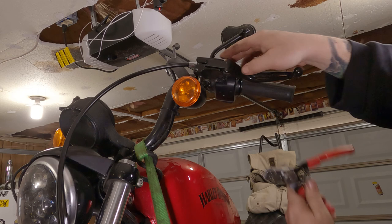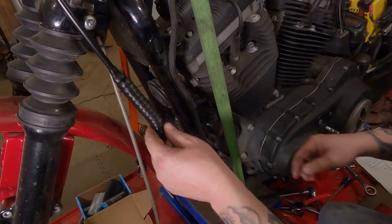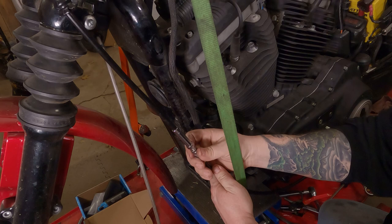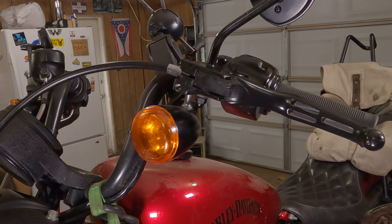Obviously, you still need to adjust the slop in there, but everything should be firmly attached now. Now on your clutch cable, slide your rubber slinky thing up out of the way. And remember, the bottom one of this spins. So you can spin that, hopefully with your hand. As you're doing this, it's essentially making the sheathing on the cable longer. Make sure this jam nut's just loose and hanging out in the middle. So you're going to crank that cable sleeve until that gap closes. This gap right here closes up on the lever.